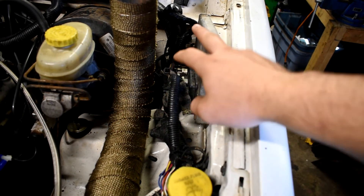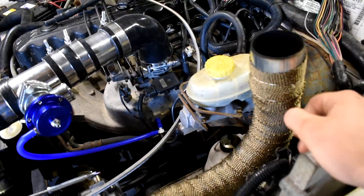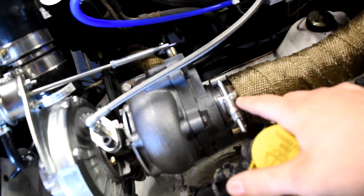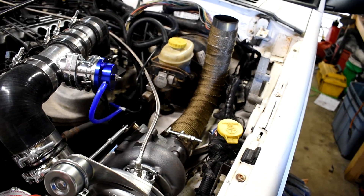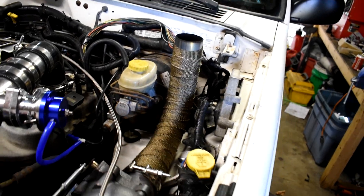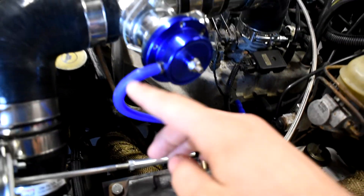For the ECU, it's not permanent yet but it's going to be in this area. Heat shielding is going to be in the works — something real slim, maybe out of flat stock. The up pipe is nothing special — it's going to come straight up. This one's a two-and-a-half-inch and I just welded it right to the V-band fitting they give you. A lot of guys are questionable about running a two-and-a-half-inch up pipe, but I've never experimented with different sizes.